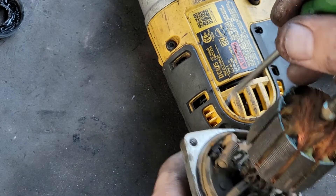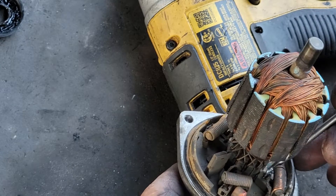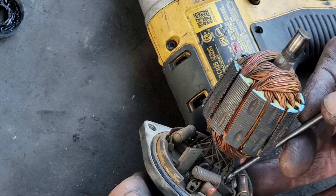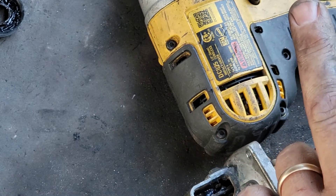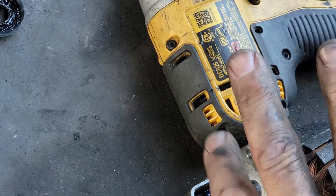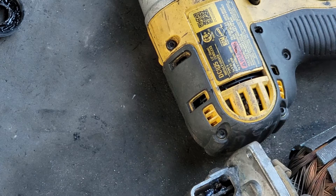These three wires — if you look at the wire on this one — that wire is being stopped by the slot because the wire is hitting the end of it. It's not allowing that brush to go any further towards the armature. So that's it — this motor is worn out.